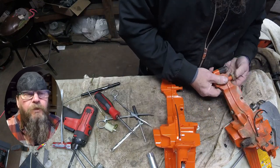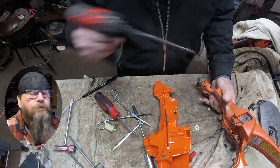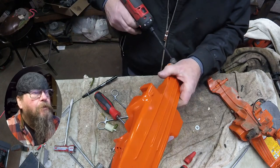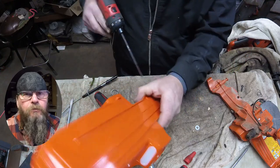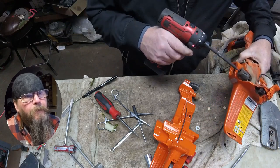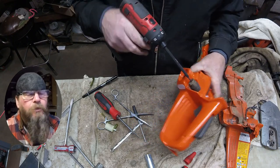So this part is really pretty easy. Put the shiny new tank on one side and the old tank on the other, and if the shiny one is missing a part that the old one has, switch it over. This anti-vibe spring doesn't matter where you lock it down — it's kind of universal. But this one, the rear one, it's got a tab on it, and that tab has to line up with some holes in the crankcase. We'll look at that later.